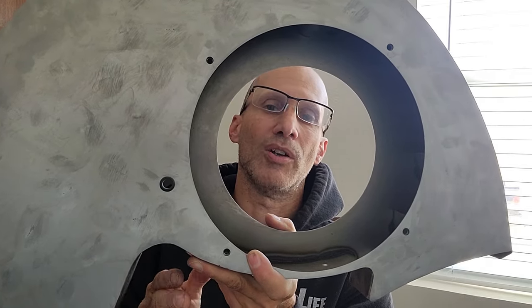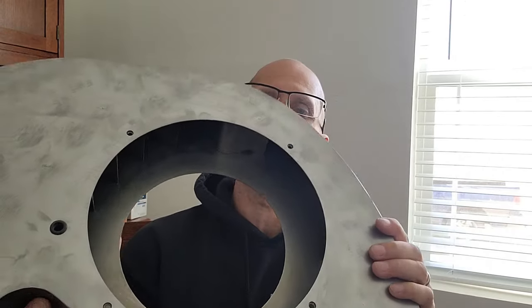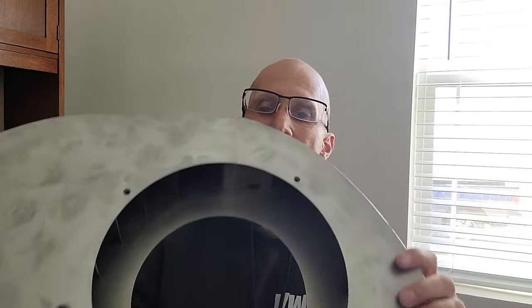But it is there in case you want to do that. The other thing about the bottom is it's fully enclosed, so no radiant heat from the top of your crankcase is going to enter into your cooling system. It will hit the underlying sheet metal and heat it up, but generally speaking this is steel, and steel doesn't have the greatest thermal conductivity, so you don't really have to worry about that very much. And of course it's pulling in air and keeping the internals cool anyway.